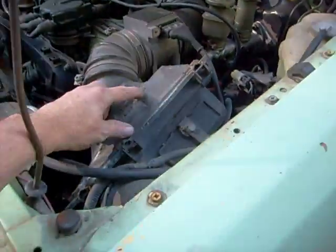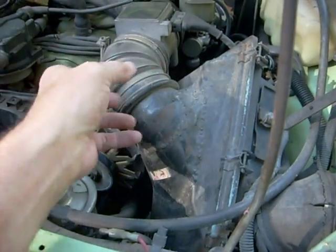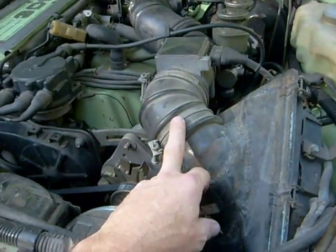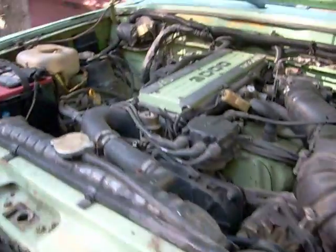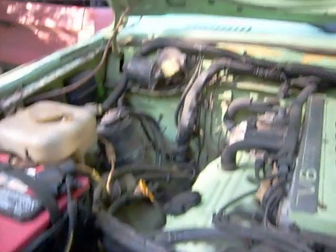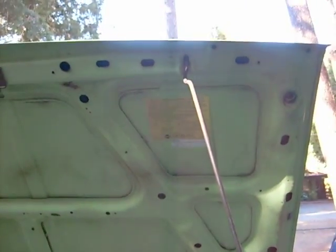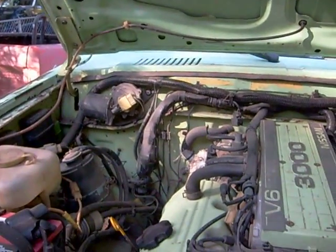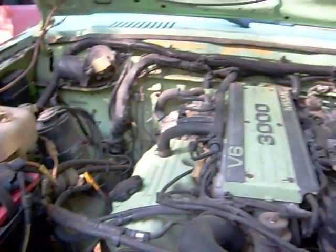The intake box is off of a 280Z that we had at the shop. I cut the snout up, flipped it around, and welded the duct back on so it would fit up here with this short hose and keep the air filter up out of the water. Everything out of the car is stock. The truck is smog legal — I even went down to Metro and got the emissions stickers for an 85 non-turbo and slapped them on the hood so the referee wouldn't give me any trouble. That was back in 92, and this thing's been smogged a half dozen times since then.